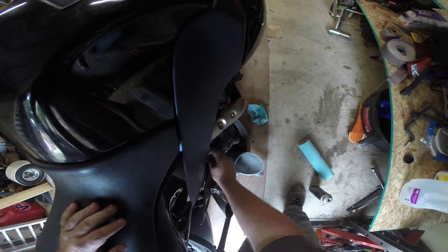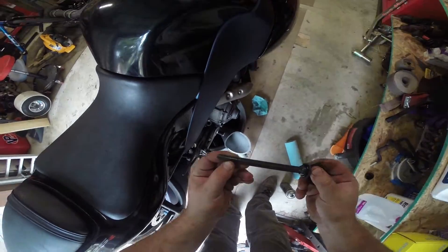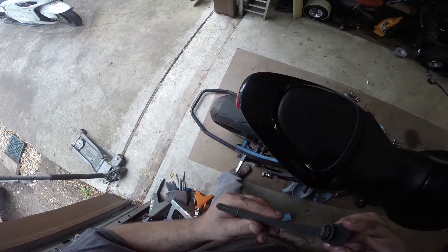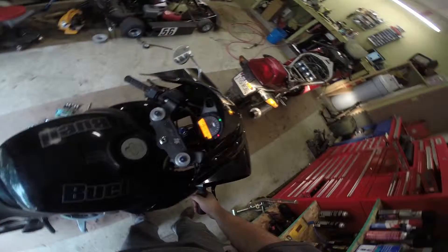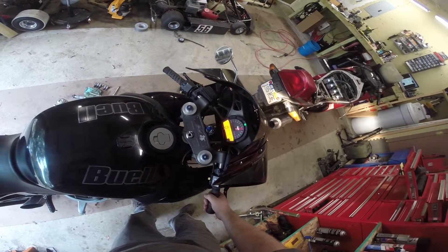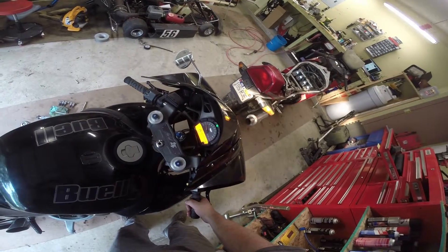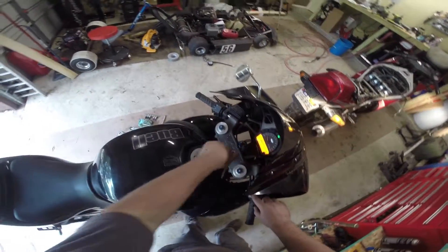Now what we're going to do is gently thread that on. Basically just turn it on long enough for the oil to circulate, then we're going to check our dipstick and see where we're at. We want to be right there — we're basically full. And there we go — oil change complete.